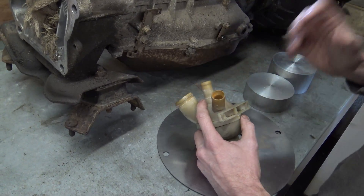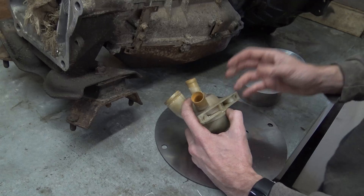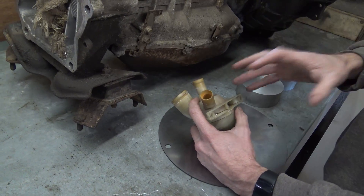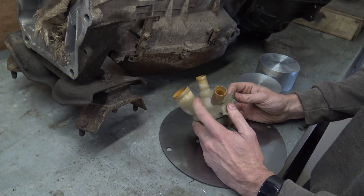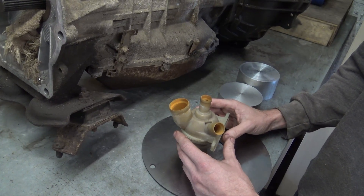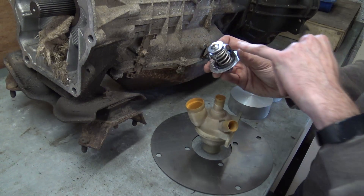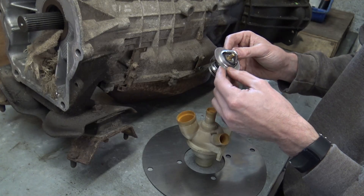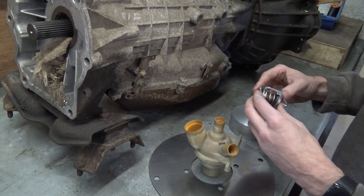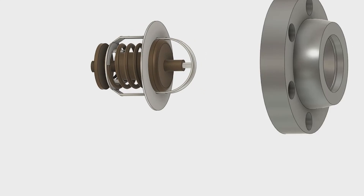Part of the whole turbo conversion for me has been retaining lots of functionality of the original car - I want to retain cruise control, there are question marks over that but it should be achievable, and I want to retain air conditioning. I didn't want to have to hack parts of the car to pieces. I wanted to do it as something that could be installed without heavily modifying the car. So my idea was to find a thermostat that has the secondary plate for the bypass shutoff - which is available in different temperature ranges. This is a 76.5 degree stat - the lowest temperature available, with two other steps up above this. Then design a thermostat housing that would fit around this with the original port configuration.